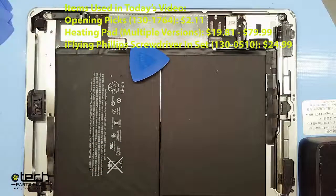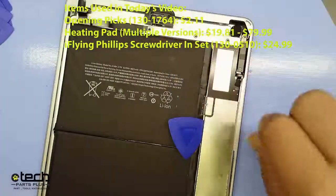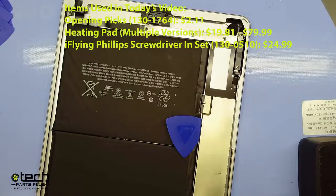That's all you have to do to disconnect the device's battery, and we recommend this on every repair — any device really. On iPhones it's really important so you don't damage the backlight circuit; same goes for iPads. Some techs will just make sure the iPad is powered off, but the problem is during cleaning, if you accidentally hold the power button too long you can power on the device with no LCD attached and not even know it's on. So the danger is there if you don't disconnect the battery.